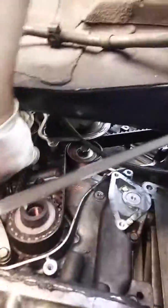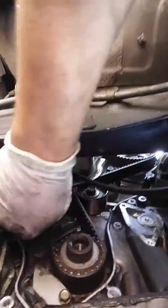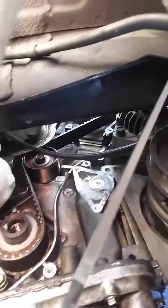We got a good fair amount of slap here, and I hope you guys can see — I know it's a little hard to see. I didn't actually measure the deflection, but during rotation it starts to get really loose, and it almost feels like there's a valve issue in the car with the fuel trim numbers. But I think it's due to the stretched belt. The belt's never been changed — it's quite old. I've had the car for 4 or 5 years and I've been a mechanic for that time, but I've never done a belt, so we're going to be doing a belt today.